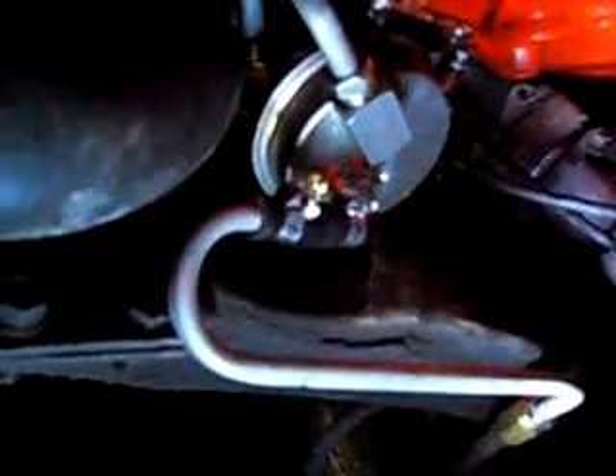Now we have this line bent down to the fuel pump, all the way up across here and into the carburetor — tucked out of the way, nice and neat. Try not to have a whole lot of rubber hose in your fuel system; just little short pieces is all you want. Here's the line under the bottom — short lines again, with some crazy bends.